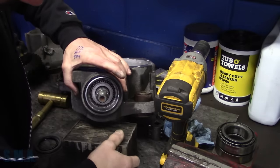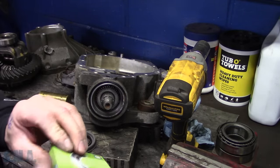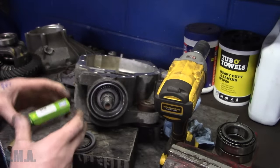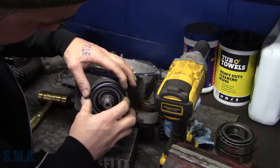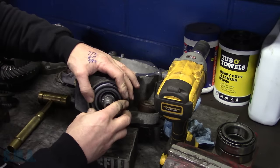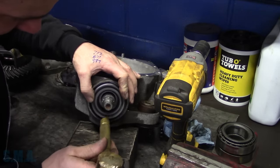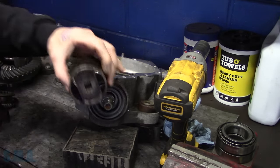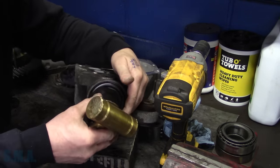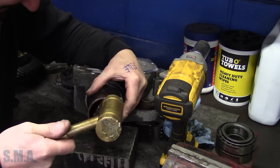However, before we get too hog wild, we should be wise installers. See, we got a sealer here from NAPA. Not a sponsor. There's our new pinion seal. Stick that up here. We'll give her a couple love taps. Let's get her started. I swear that phone is going to get some flying lessons today. We're going to use our pinion seal installer / axle nut socket.